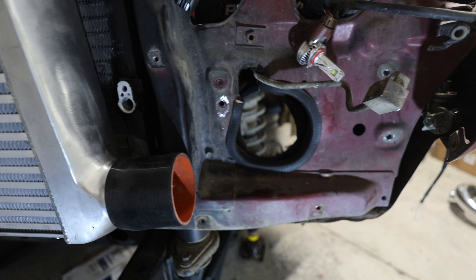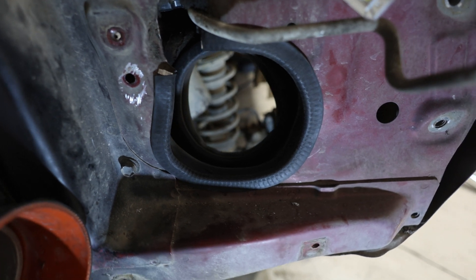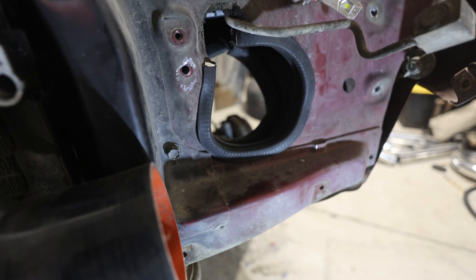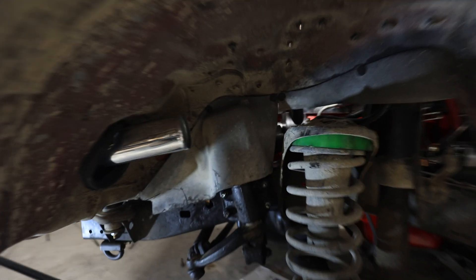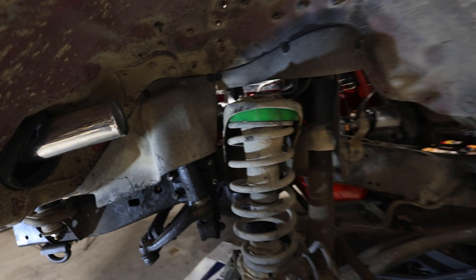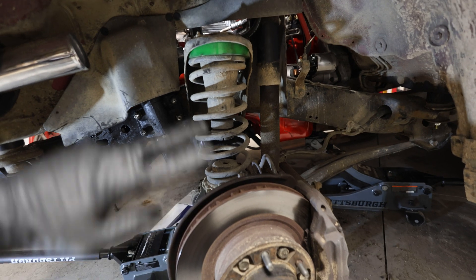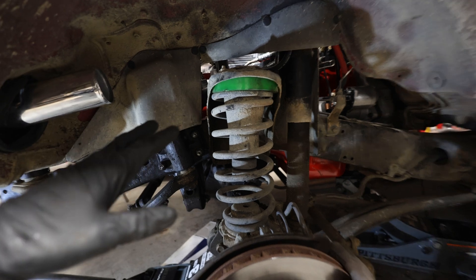We used a five-inch hole saw to go through the front part of the fender and the inner fender. We've used some weather stripping just as a mock-up to kind of clean it up and make it look a little better. I probably should have gone with a four-inch hole saw — this is a little overkill — but I just wanted to give a little room for play if the engine moves left to right. We've used a 90-degree charge pipe to go through the fender well. The tire could potentially contact the charge piping, so we're probably gonna look at going with a wider offset like a negative 38 in the future, but I don't have any issues with rubbing as of now.